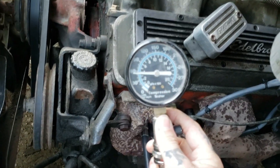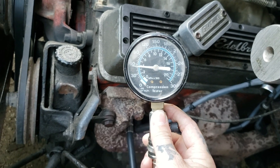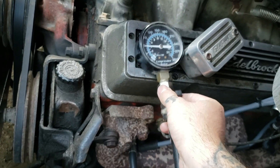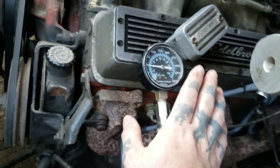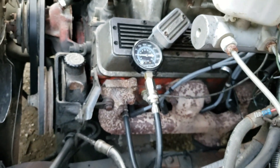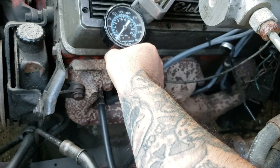As I suspected, my motor is about — wow — in this truck, that is not good. That's pretty much 60, almost 60 PSI. Not good at all. So I'm going to crank it three more times and double check it. Let's go ahead and bleed that off and set that up out of the way.